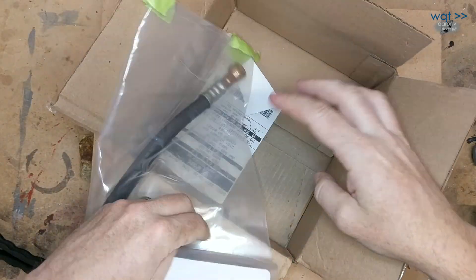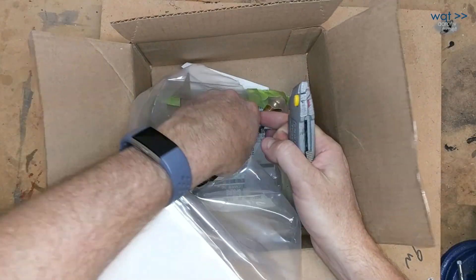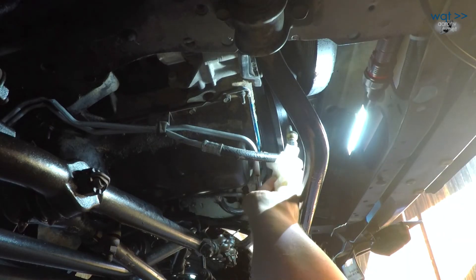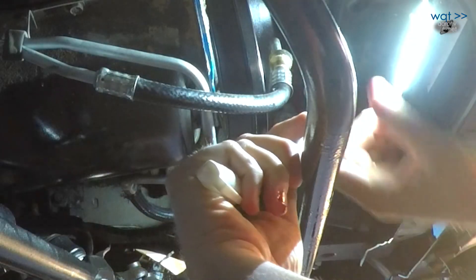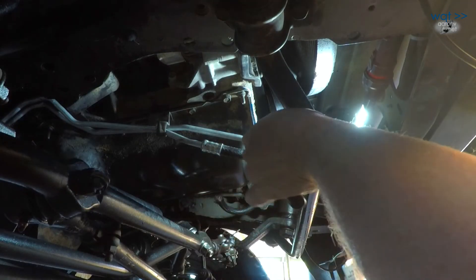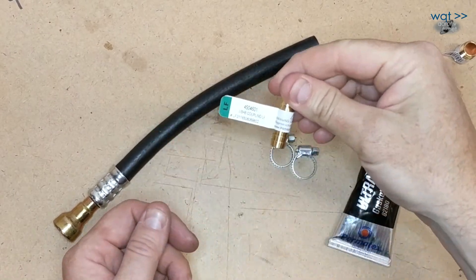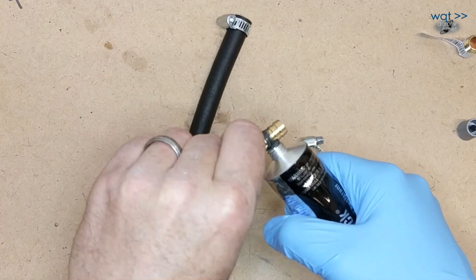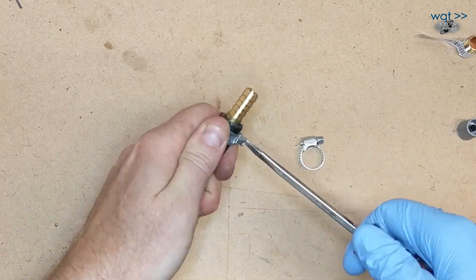Would you look at that. It's not really going to save a lot of money, but depending on what I have to do, I might be able to save a little by not having to completely strip out one of those lines. It's the quick connect and an empty hose piece. Next thing I need to decide is how long I'm going to cut this. I want it to come up over here so I can move it forward quite a bit, and then have it come back. To mimic the following you will also need a 3/8-inch by 3/8-inch brass hose barb coupler, a pair of hose clamps in that same size range, and oil-resistant RTV adhesive.